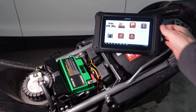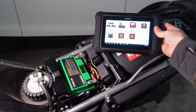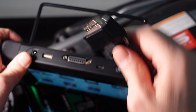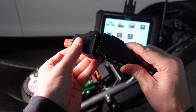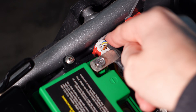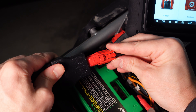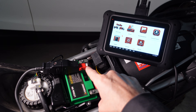Here we are in the garage with the bike. Thanks to the handy kickstand on the back, the MT700 is standing wonderfully on the bike. Taking the main cable, I connect the printer-cable-looking end into the top of the MT700. Onto the other end I connect the Aprilia adapter, and that connects to the diagnostic port of the motorbike, which can be found nestling just behind the battery. Unclip it from its little housing and connect it onto the end of the adapter — the MT700 is now connected up to the Aprilia Tuareg.